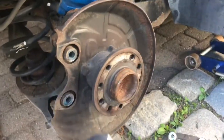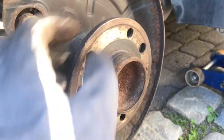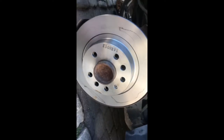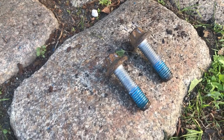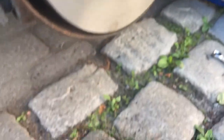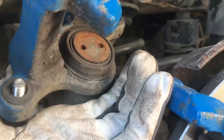When everything is freed, you can take off the rotor with the T20 and do everything in the reverse process. I put the rotor back on with some antiseize on the holder screw. You can also see one of the torx screws got a little bit of damage, so I will put that in the lowest position next time, because with that top bolt you can't really get the sockets to fit properly. I would recommend using a brake push tool for the calipers, because these need to be spun back in place.